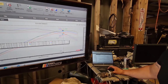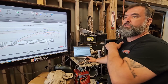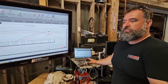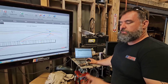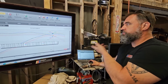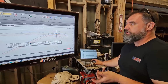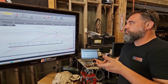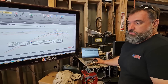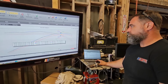Like I said, I posted all the porting that I did and went into it. I ported the runners as far back as I could get them. I pulled all the tricks into the ported LT2 that I could to get them to work, and I think the effort's showing out. I showed the work, and anybody who has one ported from somewhere else, feel free to look in yours and see what the work looks like. It's up to you.